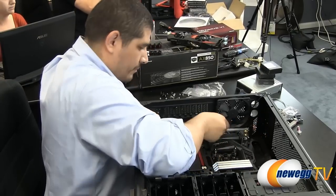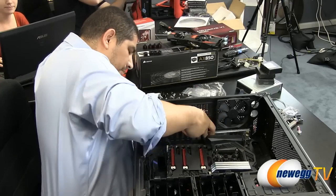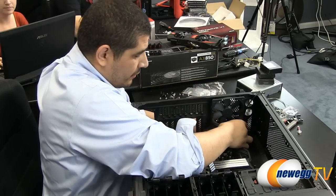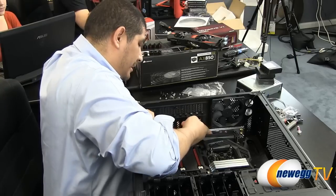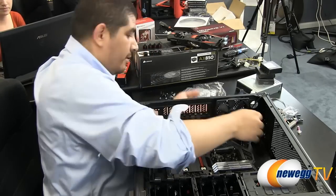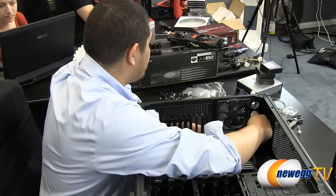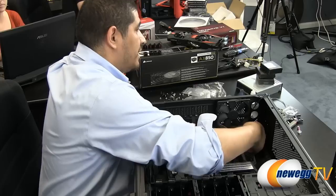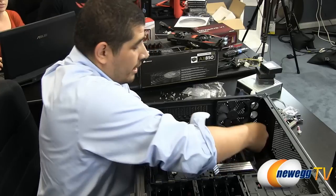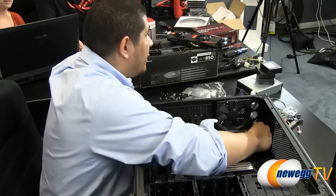Will Asus ever come out with newer motherboards for AMD? You know, we just released a brand new set of A88 series motherboards for the FM2 based platform, so those literally just came out this month, so I think that's pretty new. If you're referring to the high-end desktop side, I don't know that there's any reason to right now, because there's still only a current 900 series chipset, and we did release a refresh for that for our Sabertooth 990FX R2.0. We did a Crosshair 5 Formula Z, and we did multiple R2.0s for the M5A series. So we've got a really rich set of AMD boards right now.